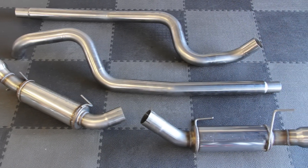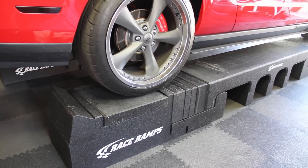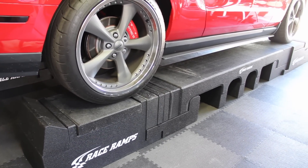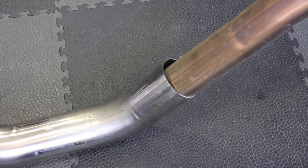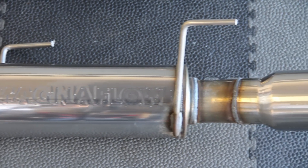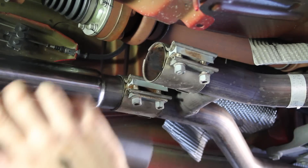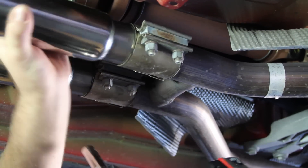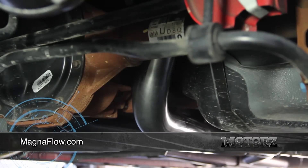Once you open up the front end — whether with a new air intake kit or a supercharger — you've got to open up the back end as well. After driving our Mustang up onto race ramps for extra clearance, we installed Magnaflow's cat-back exhaust system, which includes three-inch tubing — quite a difference over stock — mufflers, and four-inch polished stainless steel tips. For a detailed step-by-step, refer to our previous episode. Install everything loosely until it's all in place, then torque it down. Visit Magnaflow.com for more.